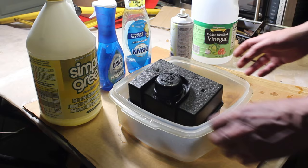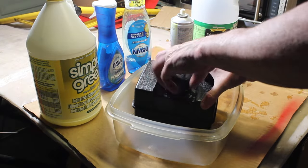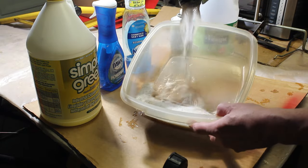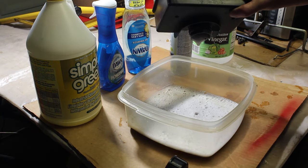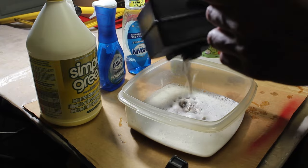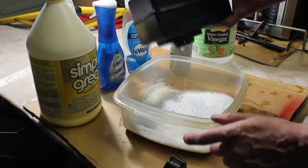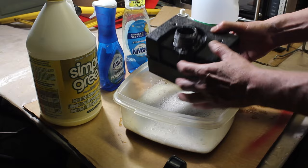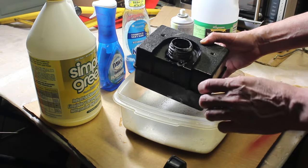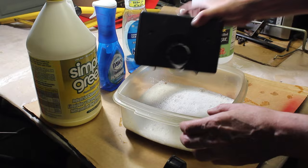Alright, 24 hours later — I see a big difference here. It's very, very brown in the container, like dark brown. I'm gonna try to empty this. Wow, that's stinky — that's the oven cleaner, which is why I say wear a mask. You can see that sludge, it's very brown. Looking inside, it definitely looks like the varnish that was layered on the bottom seems to be gone. That's really the best result so far.